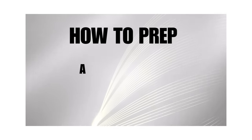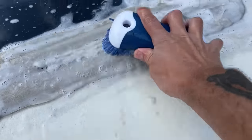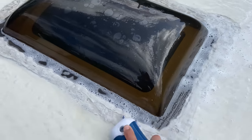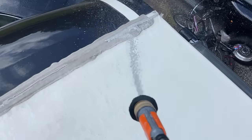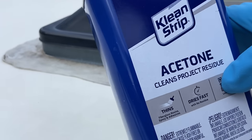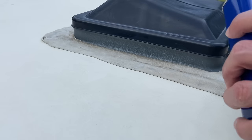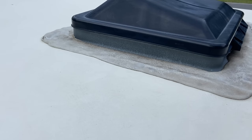Let's go over the installation process. First, make sure your lap sealant is good to go, then clean the roof. I use Gabe's Pride soap, but Dawn dish soap, Murphy's Oil Soap, or anything will work fine. You just want to get any loose dirt and contaminants off the old lap sealant before applying the Eternabond tape. Eternabond does make a cleaner and primer, but both are a bit pricey and I've never had issues without them. I scrub everything down, rinse it off, then use acetone to clean up the old lap sealant in case there's any soap residue.